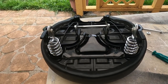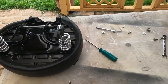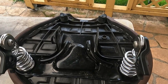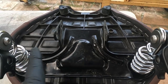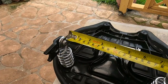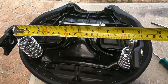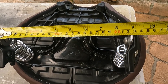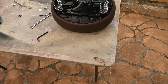So if we look at the unit I pulled off the Halcyon Gray, there it is — then we look at the one we've just done. Exactly the same. Remember what I told you about the springs: measure them to make sure they're the right width. Check from point to point — roughly 22 centimeters or about eight and a half inches. This one we've just done is the same, about 22 centimeters, eight and a half inches. Everything's right, so we can fit this to the bike.